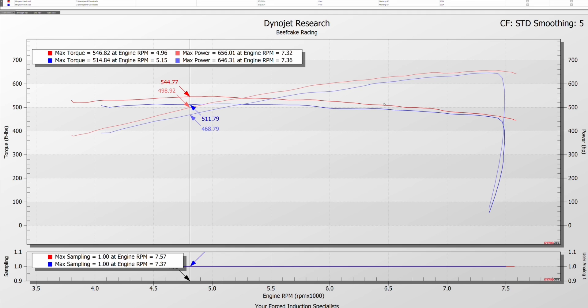The problem is this particular Whipple stage one tune has a 155 mph speed limiter. The stage two kit is either 180 or 220, so you can get a bit more — but we had the same issue hitting the speed limiter in our stage two car. Every gear you drop on the dyno costs you horsepower, and I'm going to show you that.